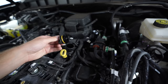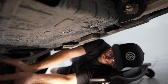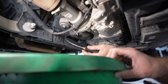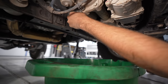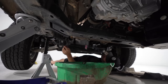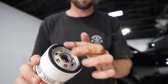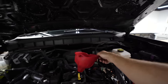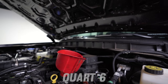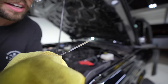For safety, take your oil cap off so air can travel through the engine. Use a 15-millimeter socket and ratchet or wrench on the drain plug — that came off pretty easy. Thread the drain plug back in by hand until snug. Put some oil around the seal and make sure the seal came off the old filter. Pull this little lever up — this is actually a small motor that takes a little oil. Just like that, we have the perfect amount of oil.